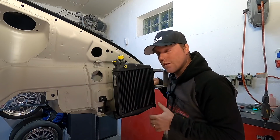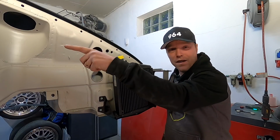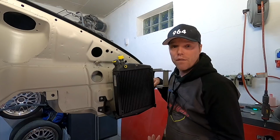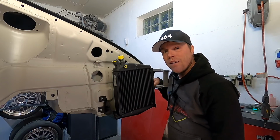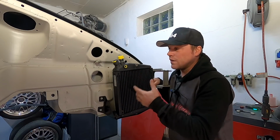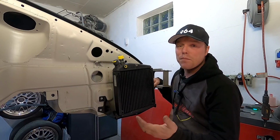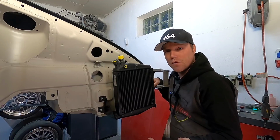The way the cooling system off of this car works is you have the fan back on the air-cooled engine that takes the bulk of the heat off of the engine and just releases it to air. Then you have the thermostat and the oil that tries the best it can to regulate the heat, giving the engine as stable of a running condition as it possibly can.